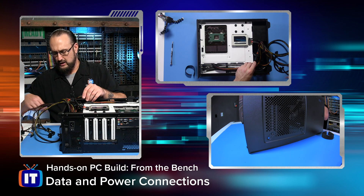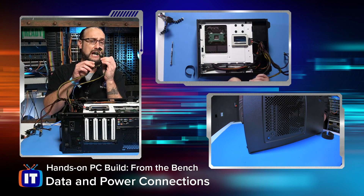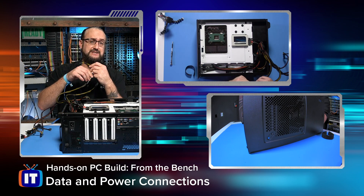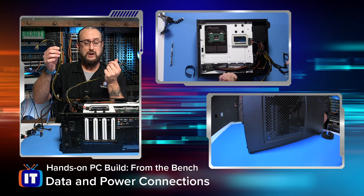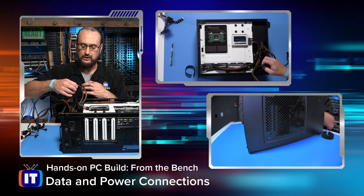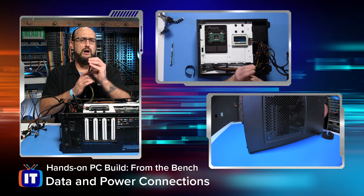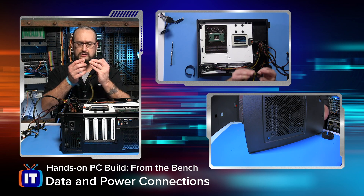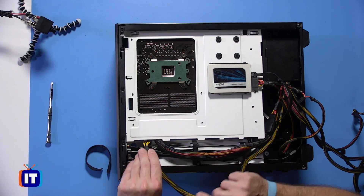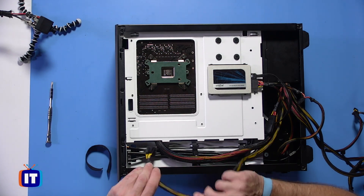You've got to be careful with your main CPU connectors and your PCIe connectors because these look identical. The good thing is they're marked on it — this one says CPU, this one says PCIe. Even though they look really, really close, like the same type of connector, you want to be sure you have the right one. A lot of power supplies today will have these clearly marked, saying CPU right on that little clip. I'm just routing these through the routing positions — the little route holes and cutouts.